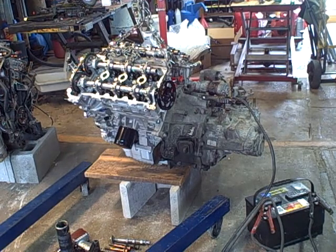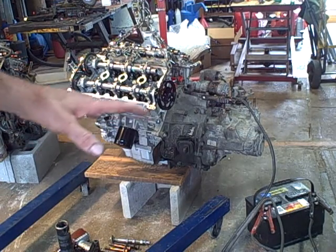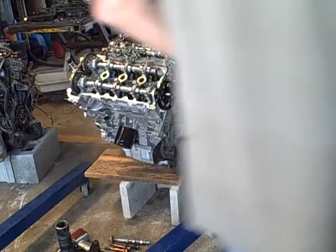I had to put the transaxle on, which I wasn't ready to do, so I could crank it with the starter because the starter mounts to the transaxle. I'm going to crank it a little bit for documentation with the starter. I've already done that for probably 60 seconds and I haven't got any oil up there yet.